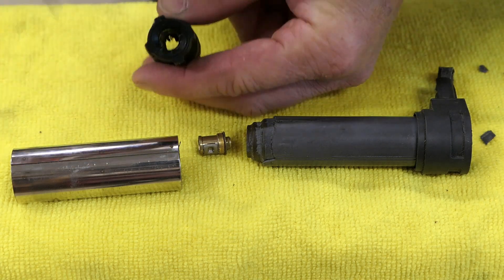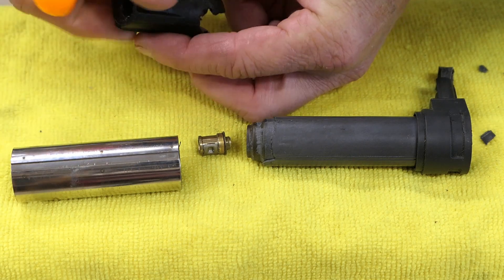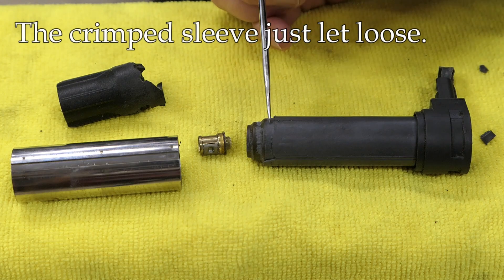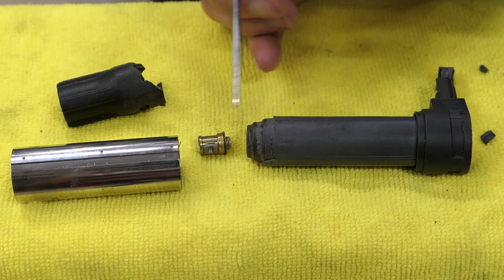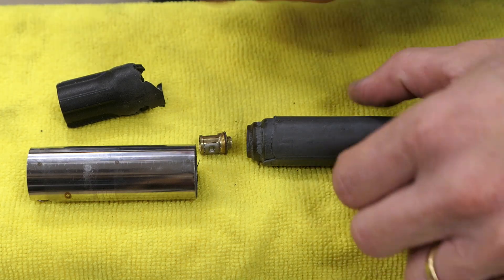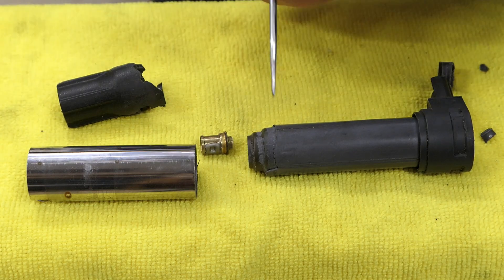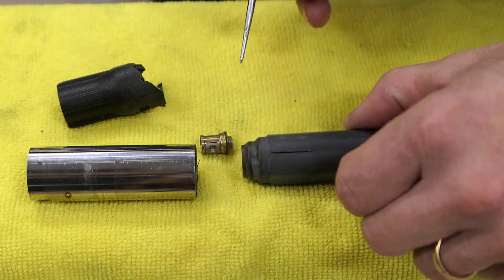The grease that I used is still in there — there's the grease. So I don't think it's welded to the plug or to the outside; it doesn't look like anything like that. I think what happened was it just came apart right here at this joint. And I didn't use excessive force either — I just wiggled it out and it popped right out. So I think this sleeve is supposed to be crimped onto here, and maybe some of this plastic broke off because I could see missing pieces. I think that joint is where the rubber meets and the sleeve is supposed to crimp it all together, and it just failed. It might just be heat, so not much I could have done about that.